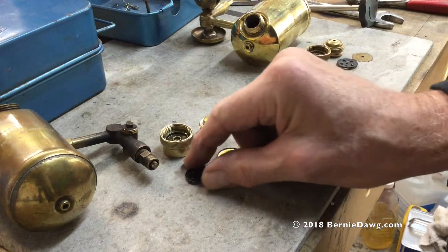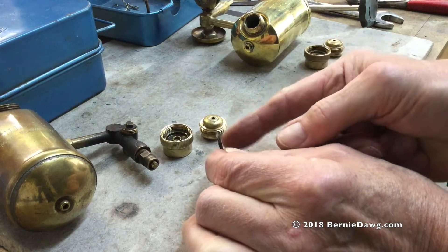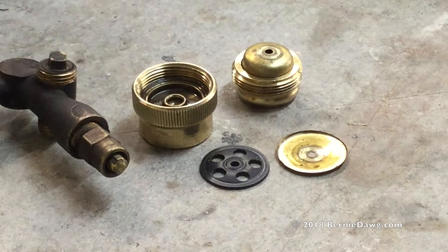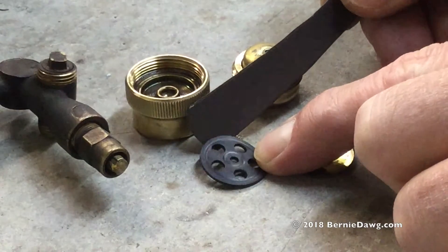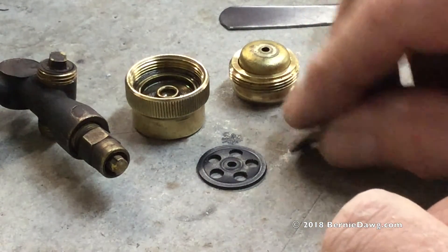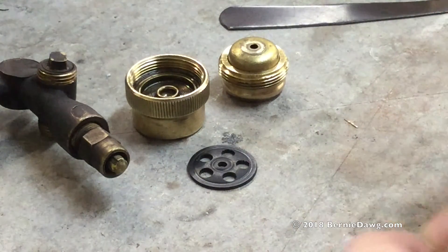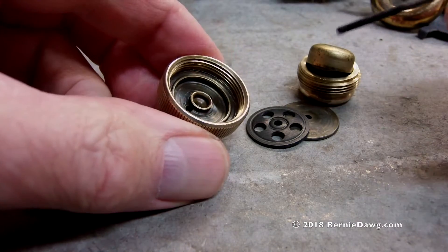In my other safety release cap, the components are fresh and almost as good as new. These are not replacement components — these are original components. You can see that the rubber washer is flat, or nearly so, and that it still remains flexible. There is no warping of the washer; it is just a flat washer — not three-dimensional in any way. The brass sheet is intact and without any cracking, in good shape. There are two seal points inside the interior of the cap.